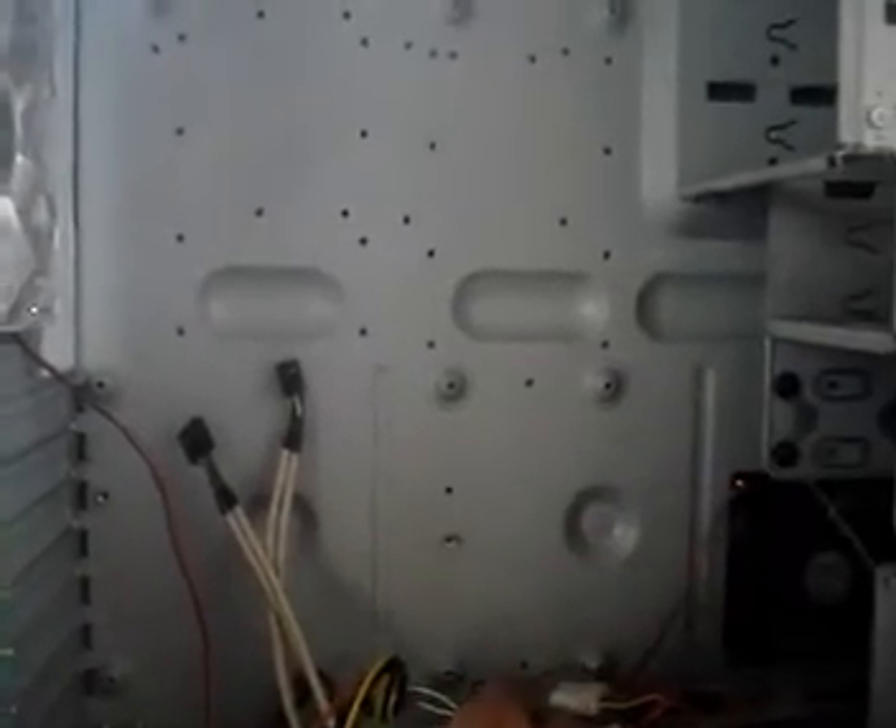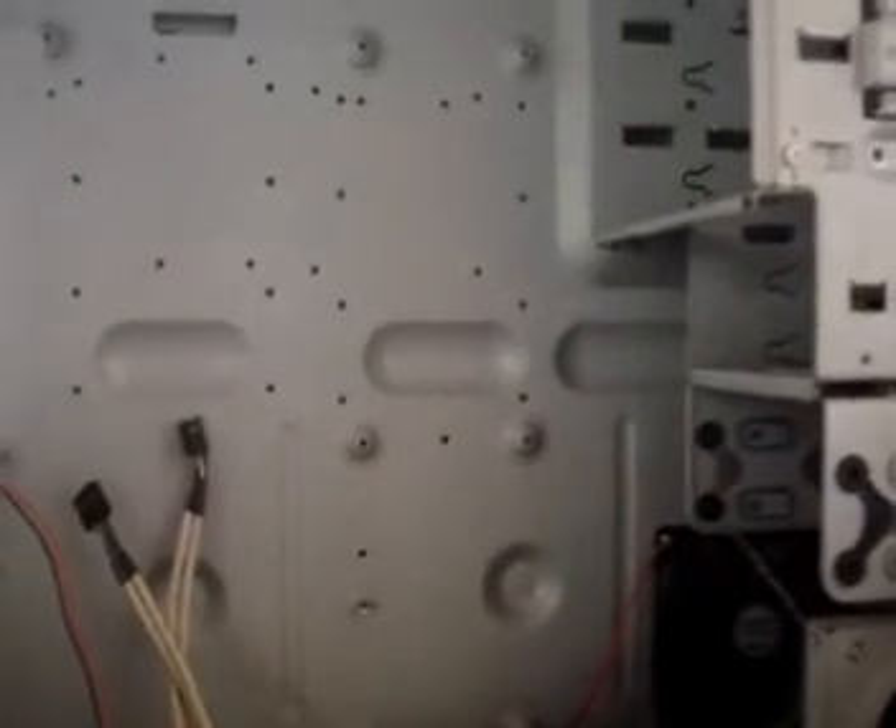The motherboard tray is designed for an ATX form factor motherboard, and on top of that is the power supply bracket. One important thing to note is that the hard drives face toward the back of the casing. When installing long graphics cards like the GTX 295, GTX 260, 285, or similar cards around 10 inches in length, connecting the power cables and SATA cables to the hard drives will be very difficult as they will interfere with the graphics card. There is also a removable wire management back cover.